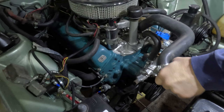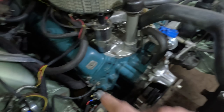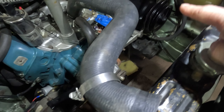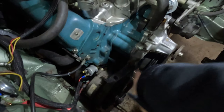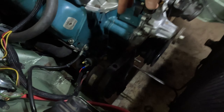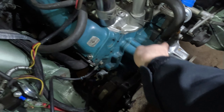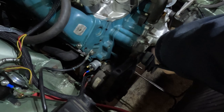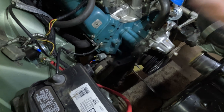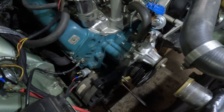Steve's already been at this this morning. He's pulling the upper radiator hose right now and then we're going to pull all the accessories off. The alternator's got to come off, the power steering pump's got to come off, and then the harmonic balancer and crank pulley all have to come off to get to the timing cover. The water pump is attached to the timing cover — there are a couple of bolts that go through the water pump and timing cover into the block. We'll set you guys on time-lapse and rip all this stuff off so we can prep for the new stuff.